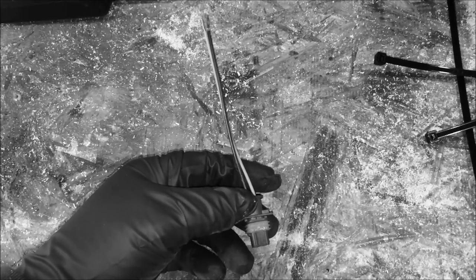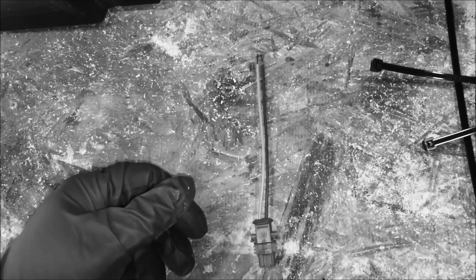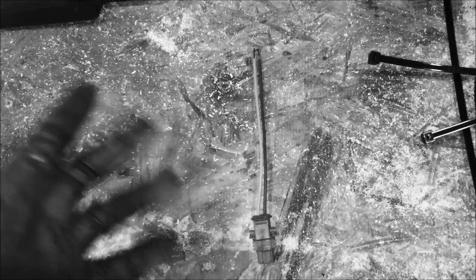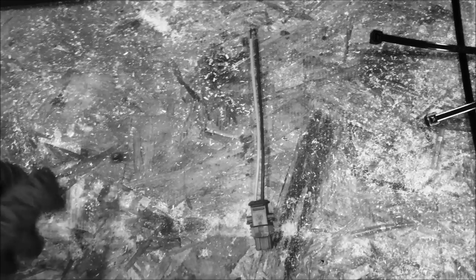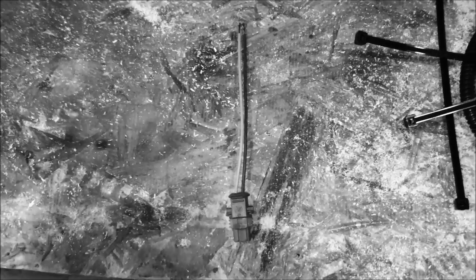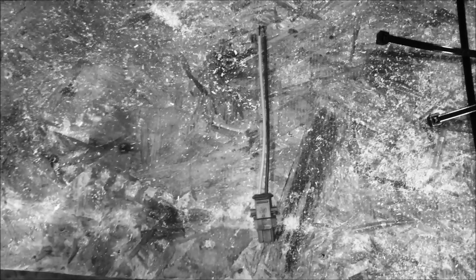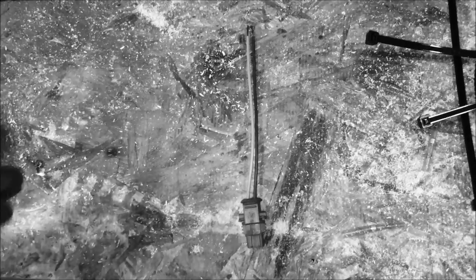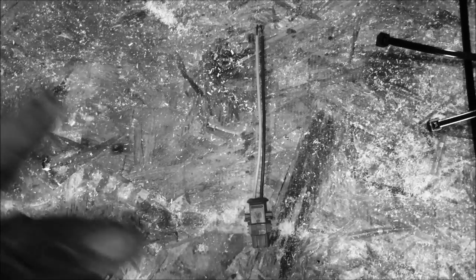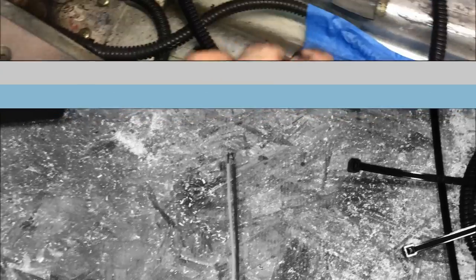What you have to do is here's the end from Polaris — remove the existing one and you have two options: you can either butt-connect it together or you can solder it. I'm going to solder it. I don't like using butt connectors because I've never had any luck with them — they always vibrate loose and cause more issues. Because of where this thing is, it's not accessible, so you might as well take the time, do it once, do it right.